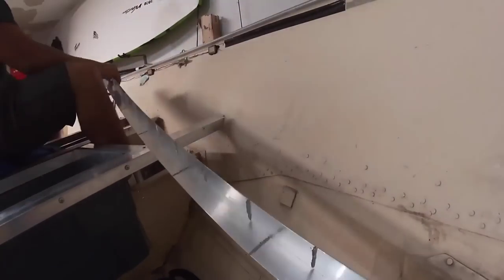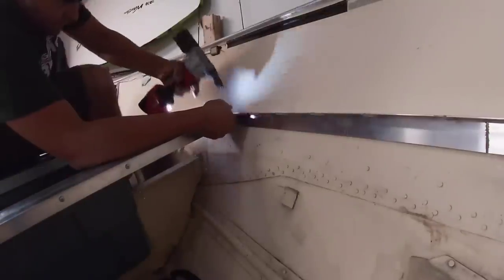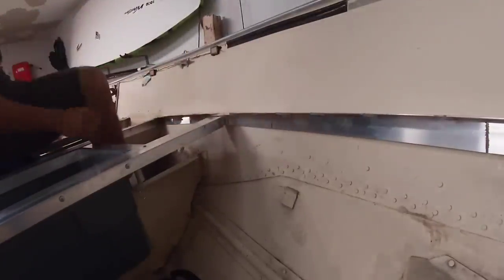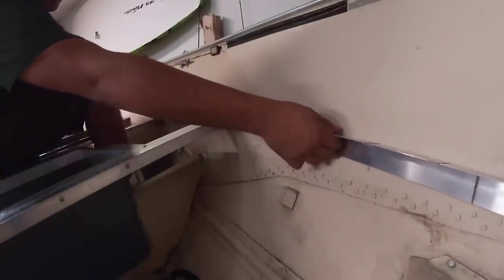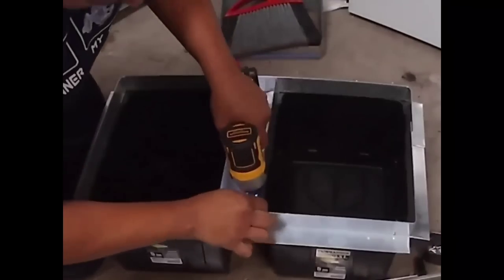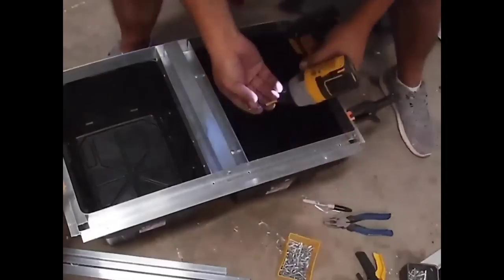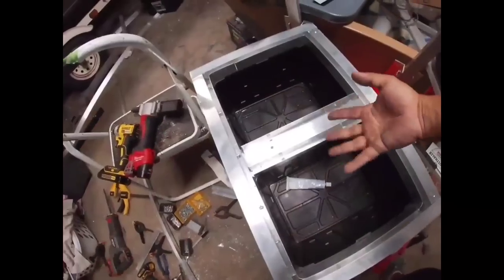We're attaching these side rails with respect to the first four feet of the boat tapering up. We're trying to be very cautious of that as we strike through to make a solid deck. We're riveting well above the waterline, so water's not going to get through those rivets — for those of you who are paranoid about it. If water's all the way up to that line, it's because something bad happened. And we're going to go through extensive lengths to ensure that's not even an option for this boat.